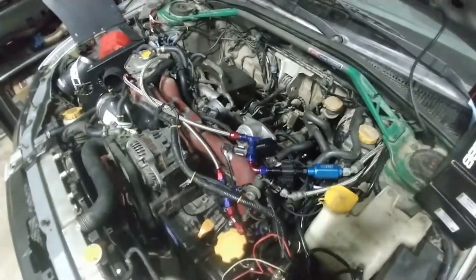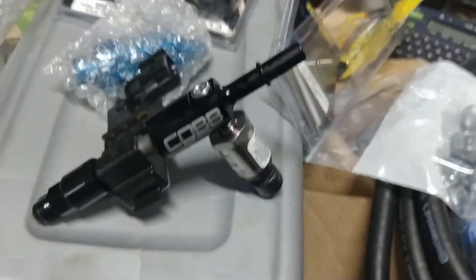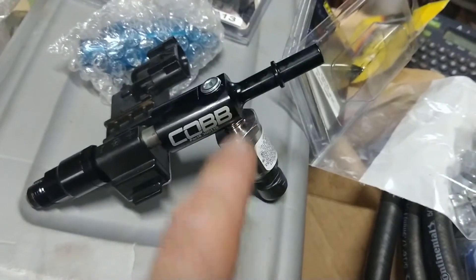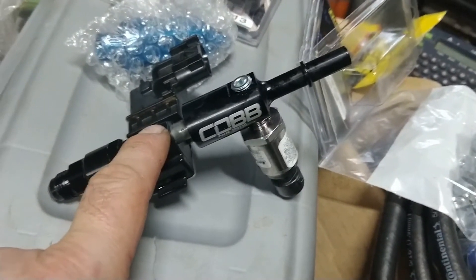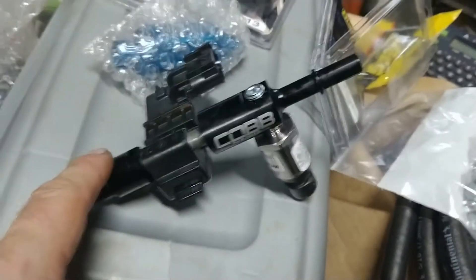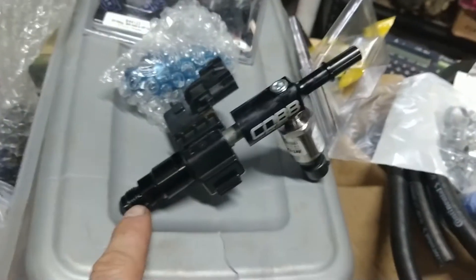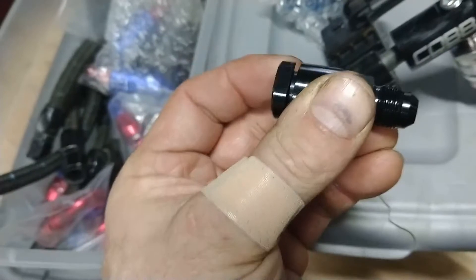You just have to find a way to do neat plumbing. I'll show you on the other car that still has a stock fuel rail. Here we have the flex fuel sensor and the fuel pressure sensor fitted into the flex fuel sensor. On both sides it's a 3/8 fitting, so here we are converting the 3/8 into AN6 fittings using these Russell 64123 adapters, which convert the 3/8 into AN6. They look like this — it's a fitting in two parts.